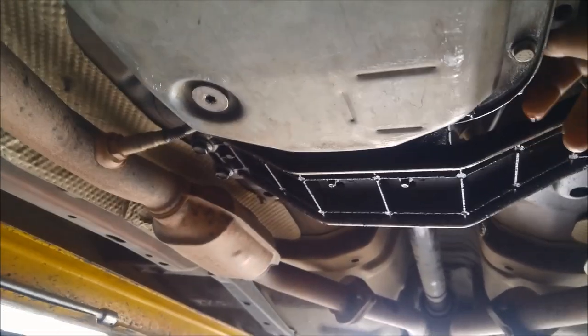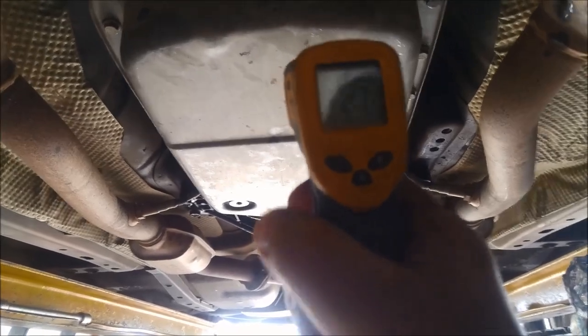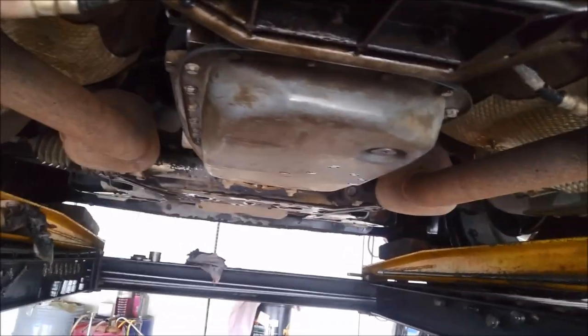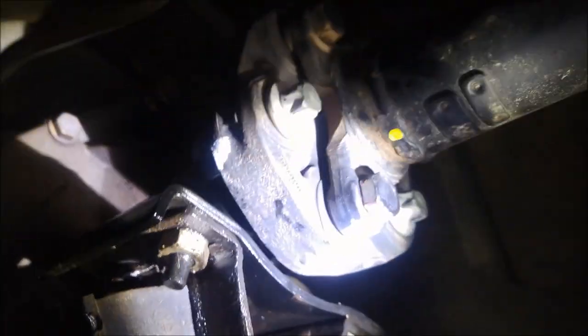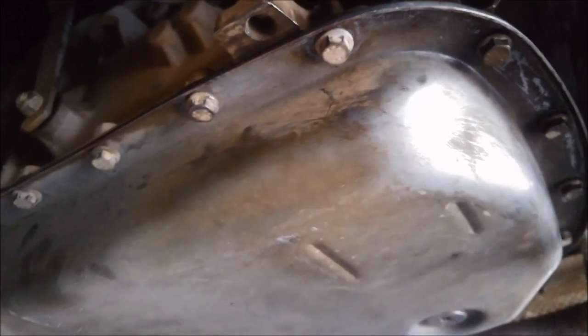I've been up in the vehicle and changed through the gears. We're on about 28 degrees, so it's pretty close — I'll take it for a run now. I've had it for a run, we're on about 40 degrees, and with the motor running I just checked it and the oil was dripping out of this little plug here. I'm also checking to make sure that seal is not leaking — and it's dry as a bone in there, you can see it under there. Also it's a good idea to blow out any oil that drips down, as it'll run along that pan rail and may trick you into thinking it's leaking. So wipe it or blow it all out.